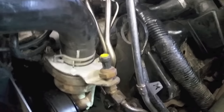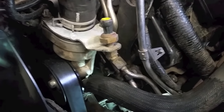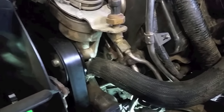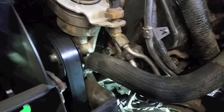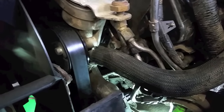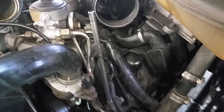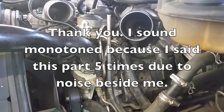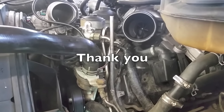The EBP controls the turbo, so make sure you have everything in place. When feeding the wire through, do it in increments — it has to go behind the thermostat housing and behind the belt pulley, the same way as the hose. Go in between the lines, feed it down behind the cover. Make sure you're behind the hose and come down through the gap. Here we have it all installed, routed properly, wrapped, and taped — ready to put the charge cooler hose and air filter back on.